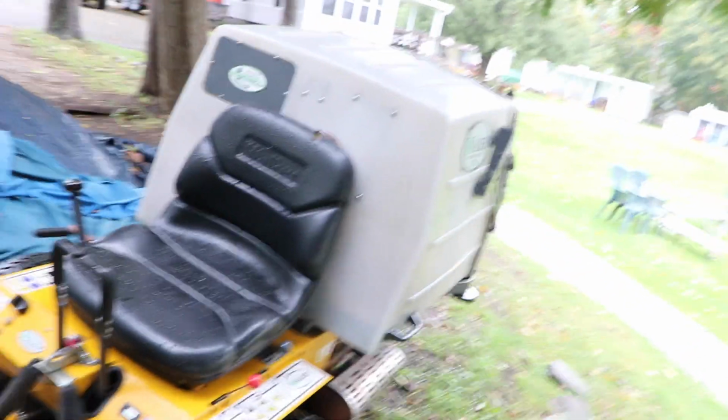And my one dealer recommended to me that I take the belt off, so in the summertime I'm not wearing out the blower when you're not using it. Well, I took his advice, did that one summer, and it seized the blower because of all the water that got in there. So I just let the belt run. Haven't had any problems with it yet. The only problem is you get the leaves in the box, but you just have to dump it every now and then.